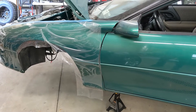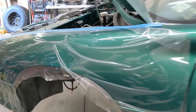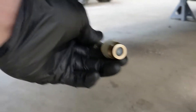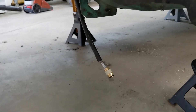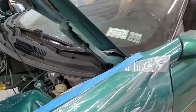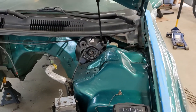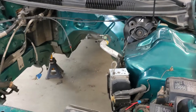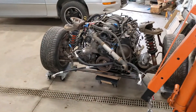It's a two-person process, but Tick has a really good video on it. Essentially, on your master cylinder on the transmission side, there's a connector with a little plunger. All you do is stick a screwdriver in that plunger and depress it while someone in the car is pressing the clutch. That way you can bleed the clutch without having to push fluid through the small orifice of the slave cylinder — you get a bigger one and it goes a lot quicker.